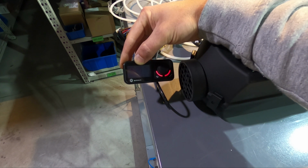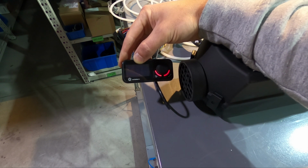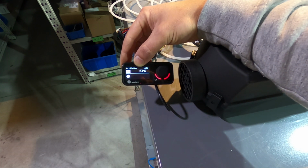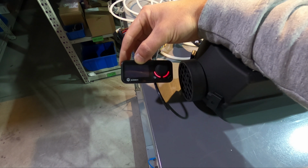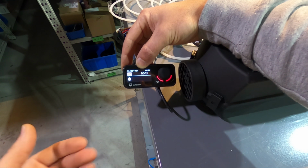I don't know what to say, guys, and this is something where this heater lacks. This is not an intelligent control. We have to take care of the battery as much as we can, and by these repeated starting processes we are just consuming a lot of power, because the glow plug takes a lot of power when it's starting. And if you have, let's say, a temperature difference of 5, or maybe if you don't have a good installation on the car, maybe you have 5 or 6 restarts in 1 hour, and that's just consuming the battery. So what I want to say, to some point it has temperature control, but it's not an intelligent one.